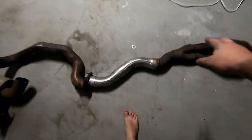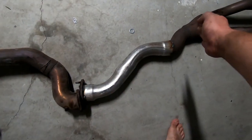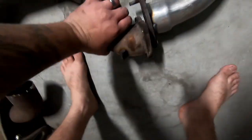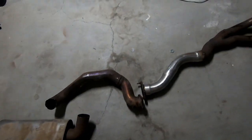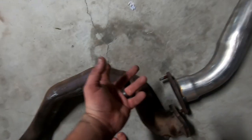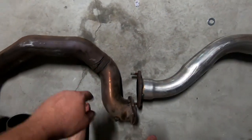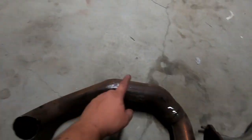Got it all out — I'm a little bit warm and filthy. This section is the crossover bit and I'll go over that more tomorrow. This is where you'd normally have that big middle muffler, but I got the muffler removed. There was a hanger on the muffler so they fitted one on this bit instead — I had to grind that off. There's a slip joint here where it must fit from factory. I couldn't get enough angle with the muffler on the back to get it through, so I'll pack that up. If someone wants the old muffler it'll be on Marketplace.